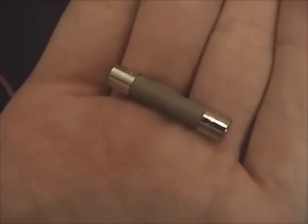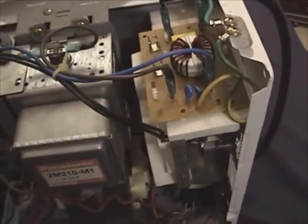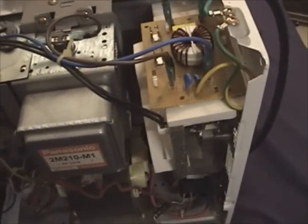Another thing we have in there is a rather small C-frame motor — smallest I've ever seen in person — with a nice plastic blade set. I just tested this fuse and it's indeed blown. There could be something repairable with this thing, but something like a cheap commodity microwave — it's really no use trying to diagnose it. Just a waste of time in my opinion.